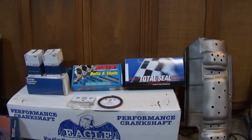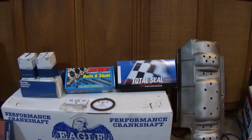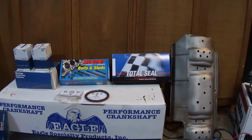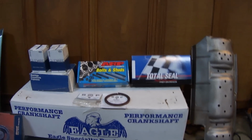On these motors, a normal motor on a leak down test will produce 7 to 15% leak down. With these rings, I have seen as low as 0.5% of leak down. Barely measurable. Great ring set.